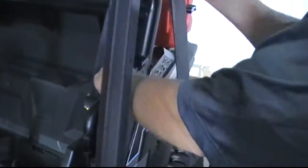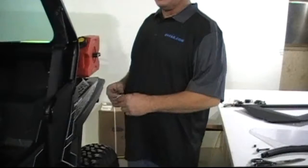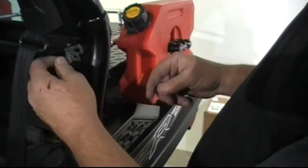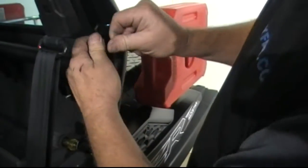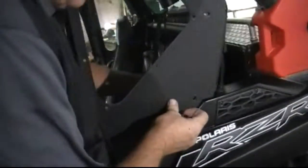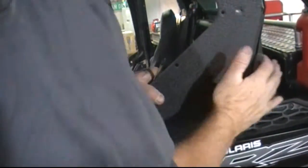Now let's start with this upper fill-in plate. Pull this bolt back out and slide it up underneath the roof. We're putting a Phillips screwdriver in just as an awl to line that up and hold it there. Now put this 3 and 3/4-inch clamp on the back side here. This particular machine has our rear window in it, but fit it into that radius right there. Now take the back panel with the 3-inch, 5/16ths bolt and slide it under the roof, lining it up.